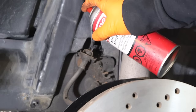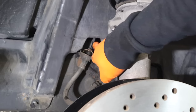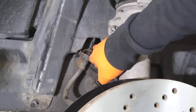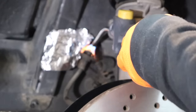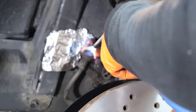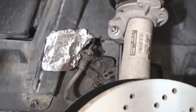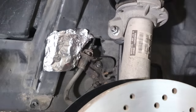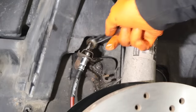We'll start with penetrating fluid. What's happening is the entire brake line up here is rotating, and the nut is seized onto the rubber portion of the line. So now we need to bust out the fireworks — if it's smoking, it's usually a good sign. Add some more penetrating fluid; it has the upside of being extra flammable, which helps in the heating process. Almost caught on fire. I think we have success — that is how you un-seize a brake line without setting your car on fire. Almost. Now we're going to take our new stainless line and put it in the caliper first.